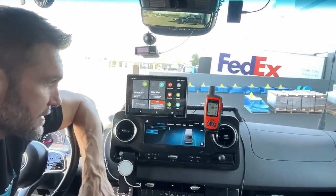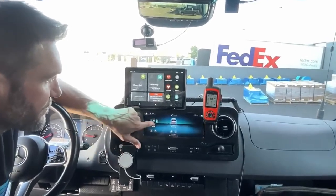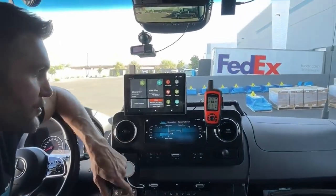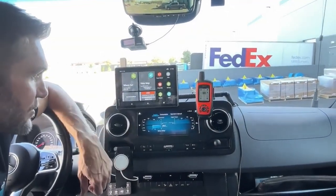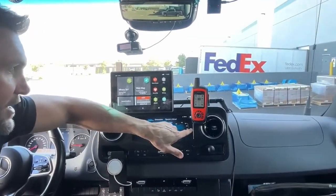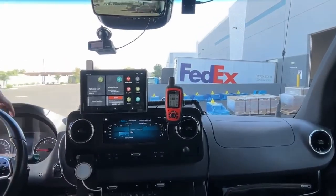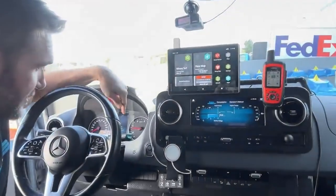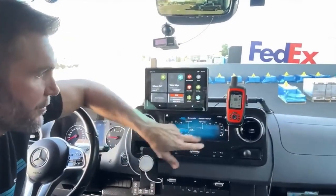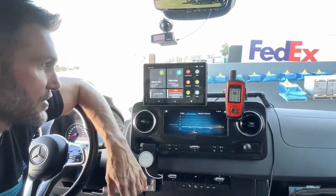You can also turn off your parking sensors there — touch the button that looks like the front of a Sprinter and turn that off. While we're in here, if you scroll over to 'info' you can get some useful information while driving: transmission fluid temperature, oil temperature, engine torque, engine performance, battery voltage, and consumption. These are different from your engine temperature, which is your water temperature over in the main cluster.